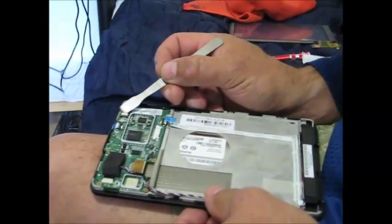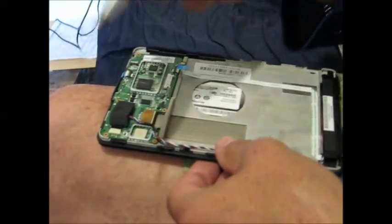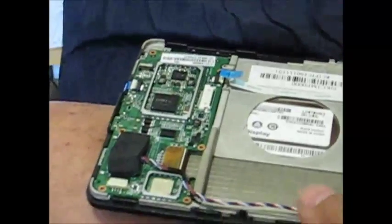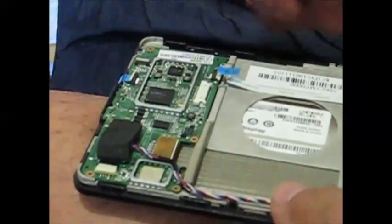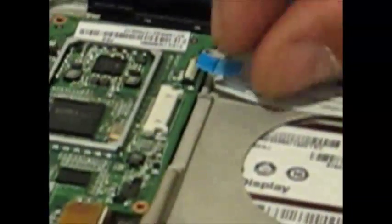Because I've taken the digitizer off already, it's just this little clip here — you just pop this up very gently and it pops out. There are two screws holding it down. You want to take a very, very small screwdriver, a very good quality one, because otherwise they'll strip the screwdriver — the screws are actually quite good. Undo the screws, take this piece out of the way. Next thing, pop this up. There's another one over here which is supposed to be connected to a light ambient sensor, but they don't even use it — they've changed the programming so this doesn't do anything. Pop it up and just pull the tab out so it's out of the way.